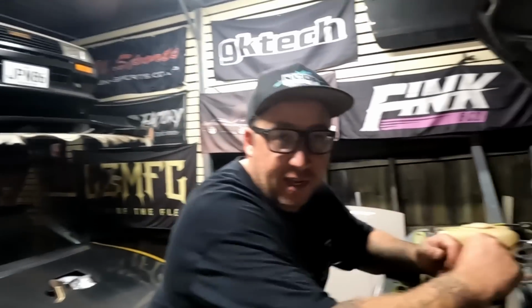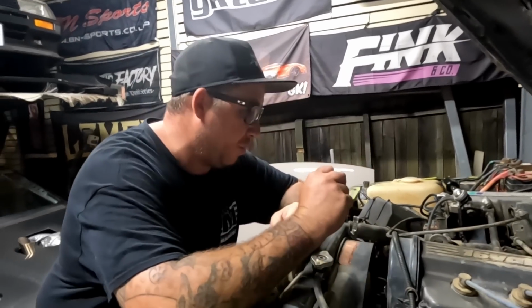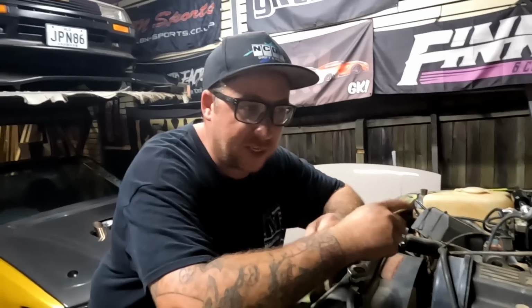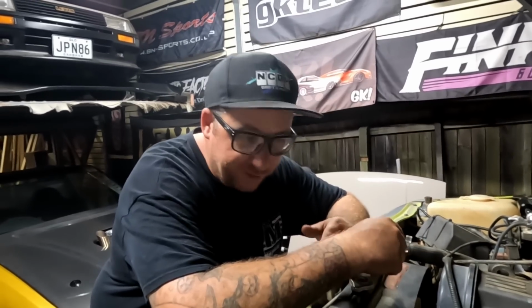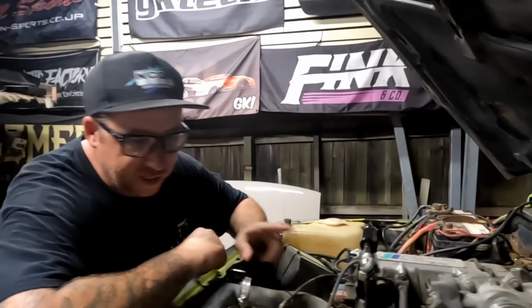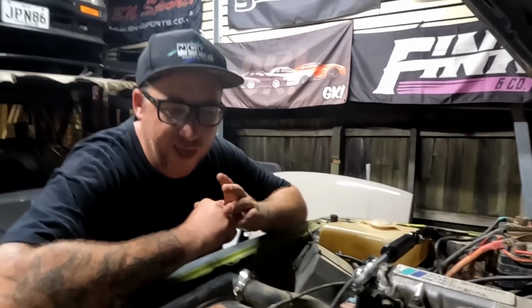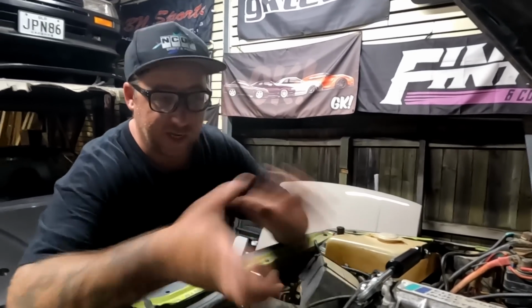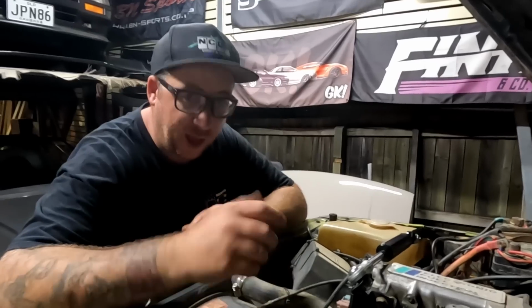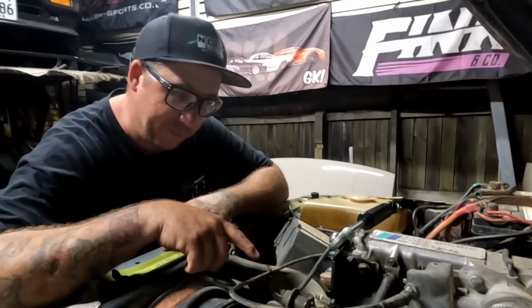Yeah. Rightio, as you can see, darkness has come upon us. I've been busy, but I didn't film. I don't know why. I just get busy and I forget to film. But I do have an issue with the Suzuki because it makes so much torque with the 1.6 single cam that it really does try and tear the motor out of the car. And that engine mount down there is a bit how you're going.